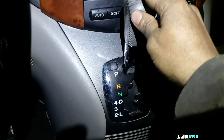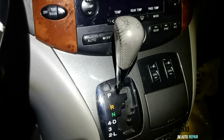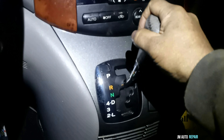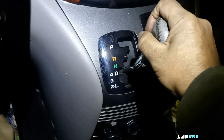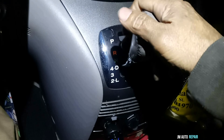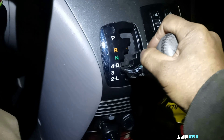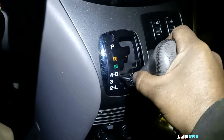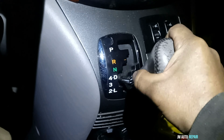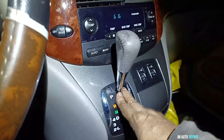Make sure the emergency brake is engaged and the vehicle is parked on a flat surface. Your foot also has to be on the brake pedal. This doesn't have to be done with a scanner — I'm using my scanner right now, but you can also use a temperature gun; you just have to go beneath the vehicle and check the temperature at the transmission oil pan. I paused about 3 seconds in each gear — Toyota doesn't specify that, I just prefer to do it — then I returned to Park.